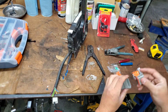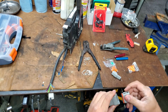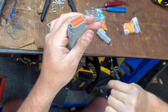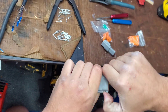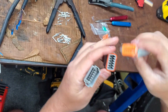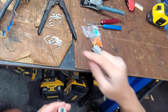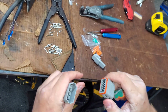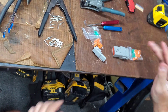You can see the connectors laid out. Give it a little spit and it'll go right in. If you put it in the right direction it'll slide right in and connect. These have gaskets so that when you slide the wire in it's going to be sealed up tight. This orange piece goes on there so that when you put the pins in from the back — your male and female pins — it holds those pins in the exact right location so that when you plug it up it'll pop right together.